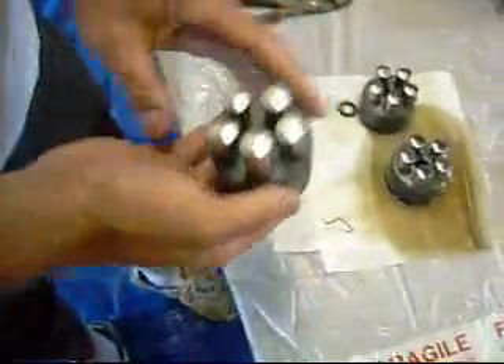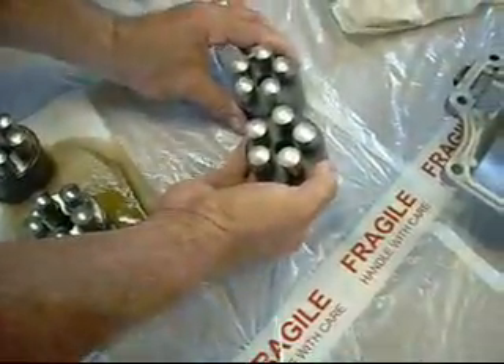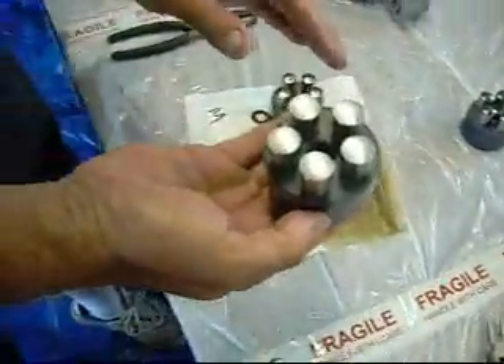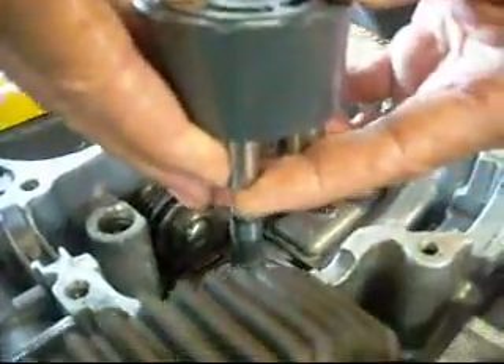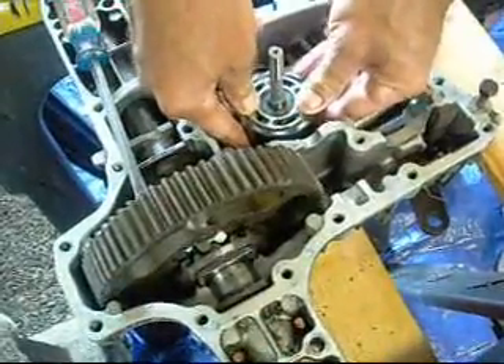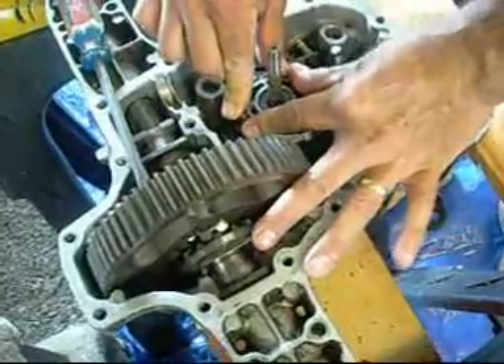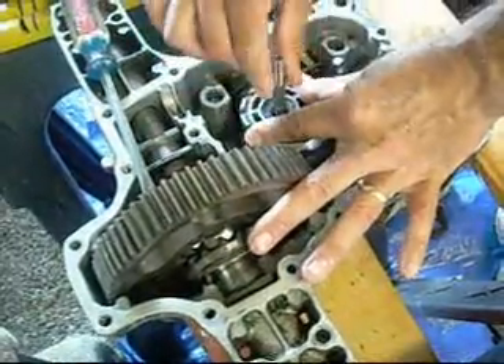We're going to take the pump assembly, which is identical to the motor assembly in the K66, and install that on the pulley shaft, holding the pistons in place with some fingers. It's in, it's on the spline shaft, and I've got positive springs in all the pistons.